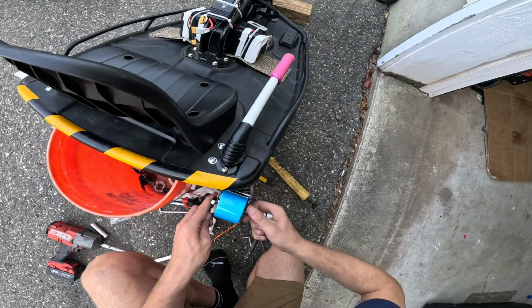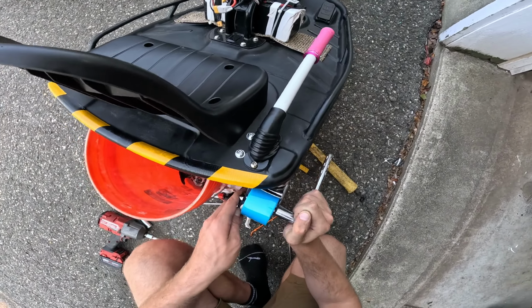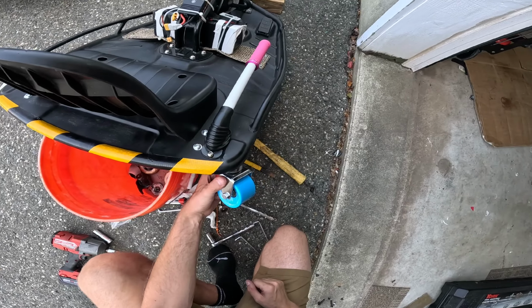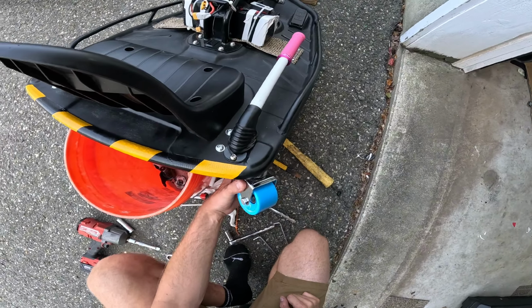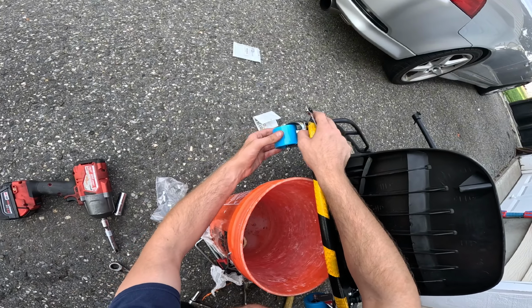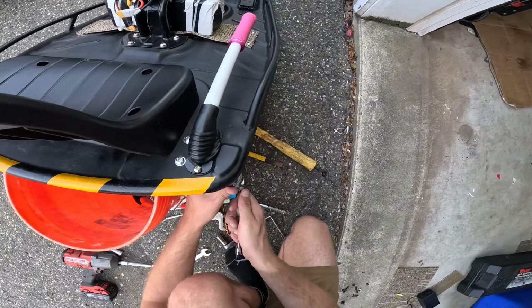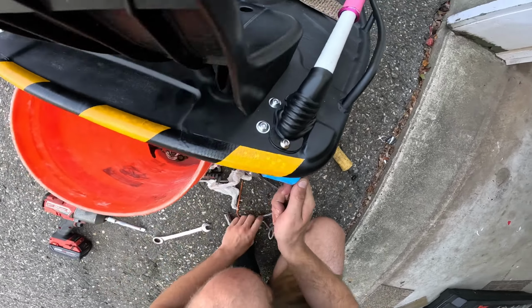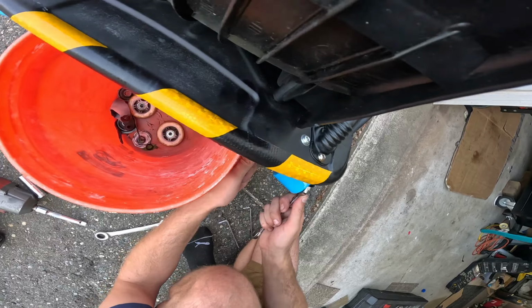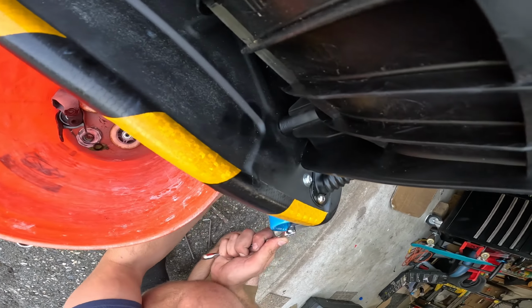that caster up. Make sure it's not too snug. Sometimes if your sanding job wasn't perfectly even, if it's too snug, it will actually apply uneven pressure on the center of that wheel, making it not spin freely. So if it's too snug, back off a half or a quarter turn, and you should have enough movement in that wheel. You can also use blue Loctite on these, but since I'm going to be replacing wheels quite frequently on this thing, I'm not going to put blue Loctite on the center axle and nut here.